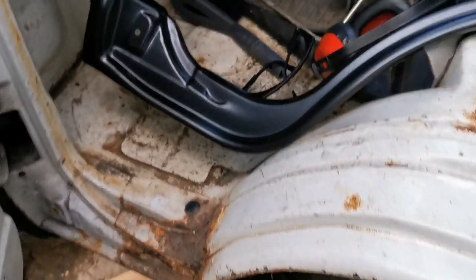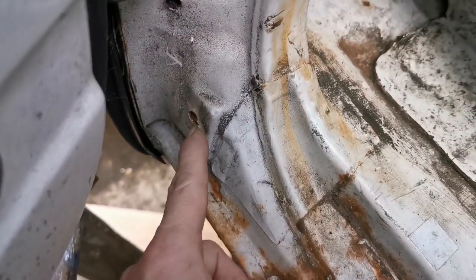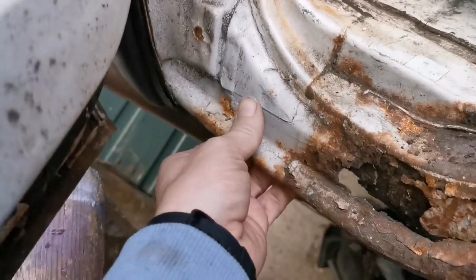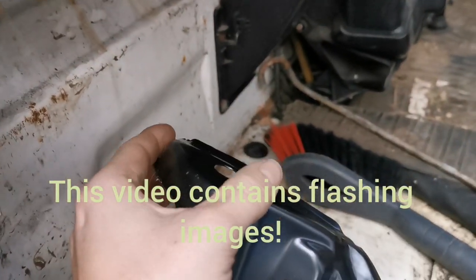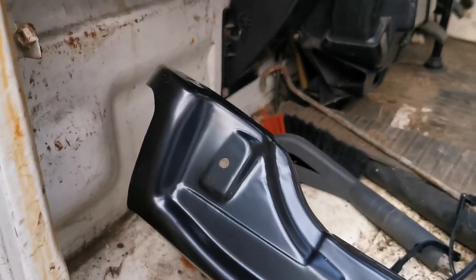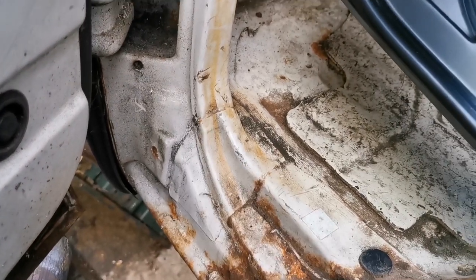The first thing I'm going to do is measure up. You can see there's a hole there, and that matches the hole on the new panel here. I'm going to mark around as far back as I can go so I can cut this, because at the moment I can't line it up side by side — the lug would go inside, which we don't need. So the first job is to carefully trim that panel back, coming around this edge so we can then mark it up.